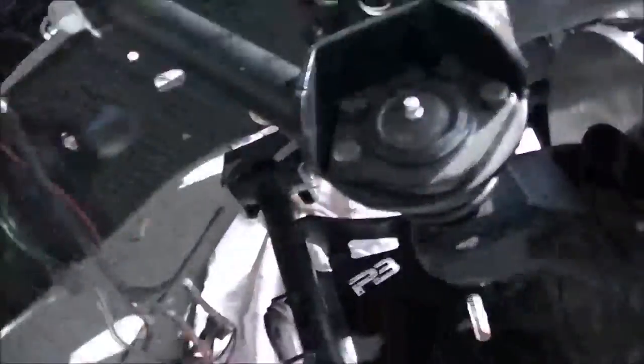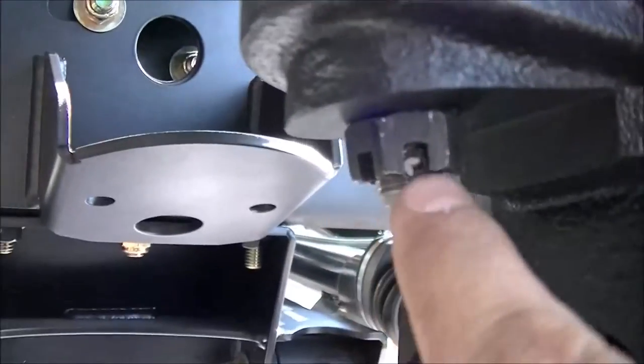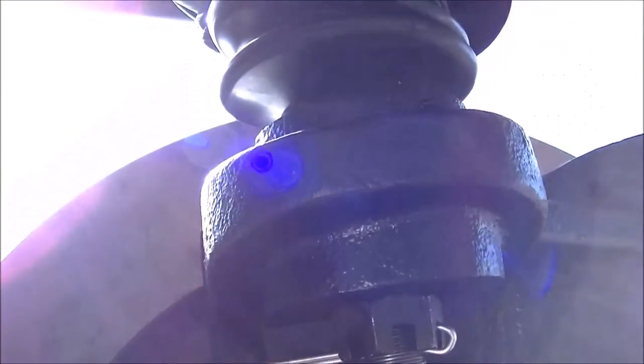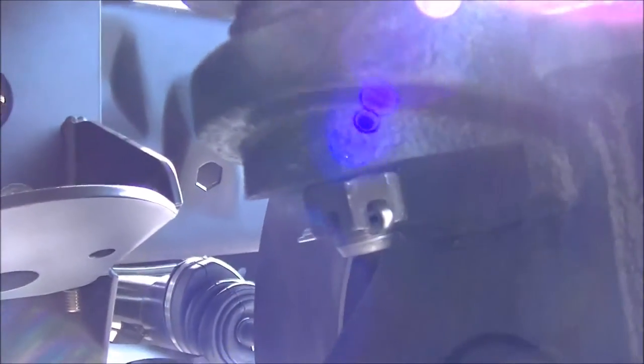Another thing we're doing today is tightening up the ball joints. By doing that, you're going to put this castle nut on, and then you're going to want to put this cotter pin in here. The pin's going to go through - make sure you tighten it so you can see that little hole right there in the spindle. Then slide this through like that, make sure it goes all the way in. You're going to want to bend this piece down and then this piece up so it prevents it from spinning off.